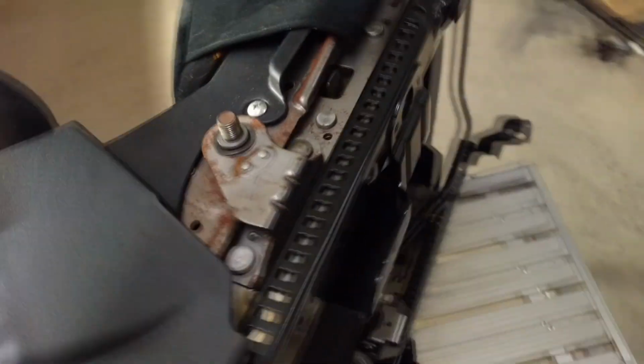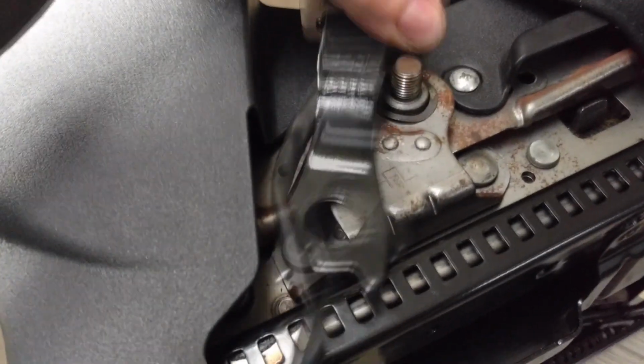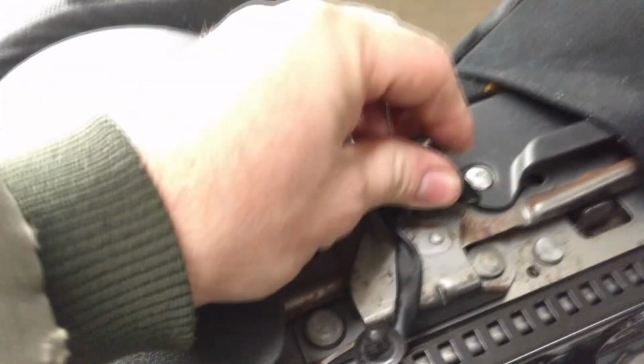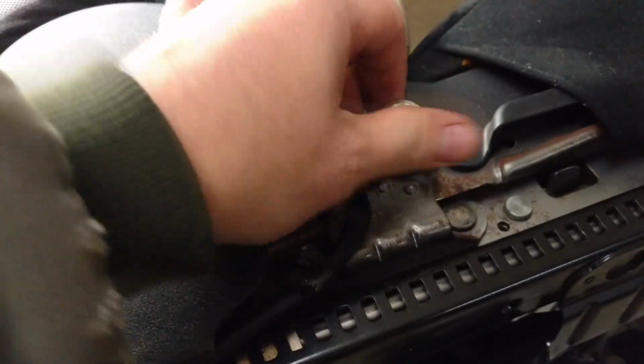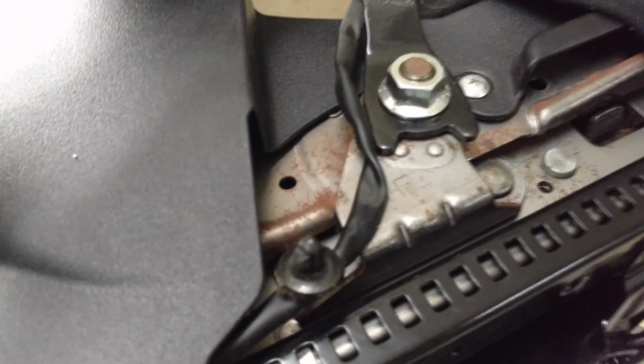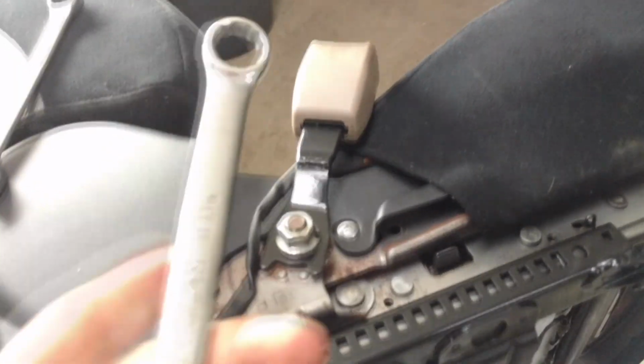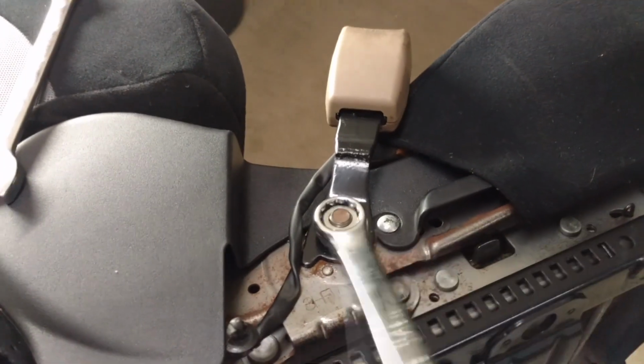We're going to take the seatbelt bracket back over to the seat. Set it on there. There's a little spring washer to keep some tension on it. Set it on here, one-handed. Get the nut started. Like I said, as you get this one tight and snug, it'll get to where it only wants to bump into those two dimples right there, and it keeps it within grabbing range of the seat. Let's see if I can find the wrench for it. It is an 11/16 that fits. Alright, that should be plenty. It's tight, not going to come off.